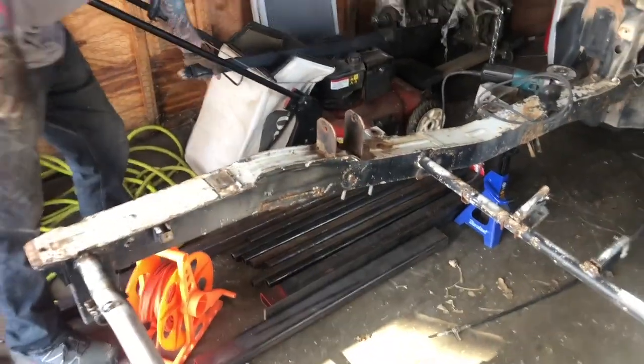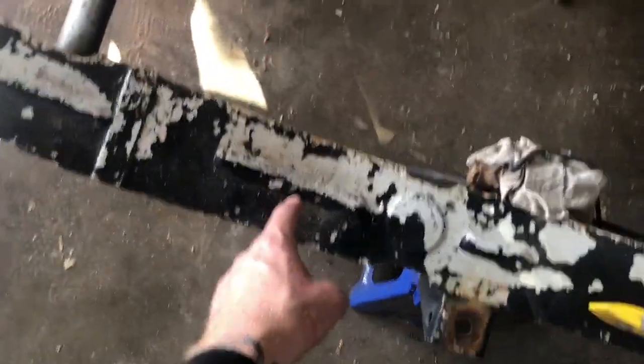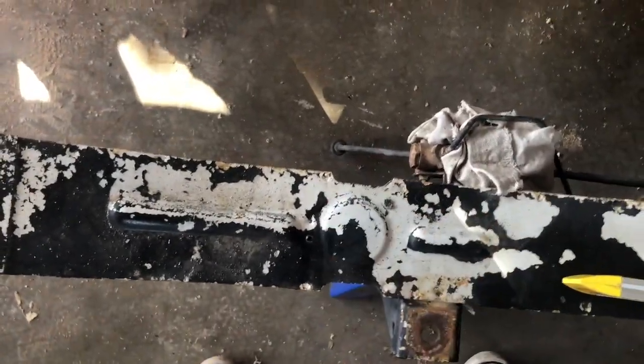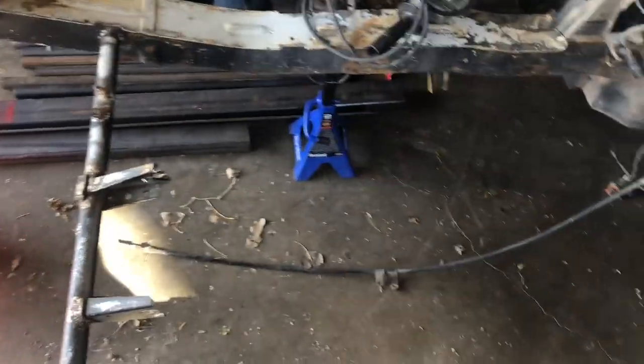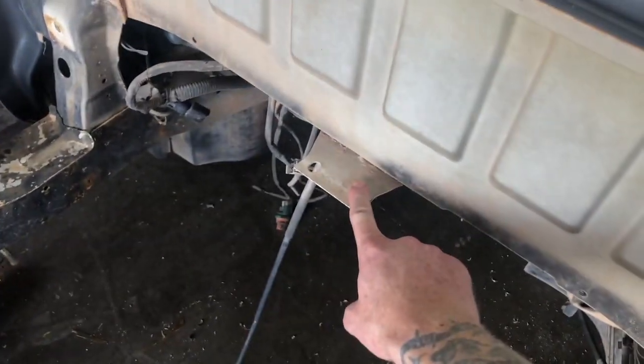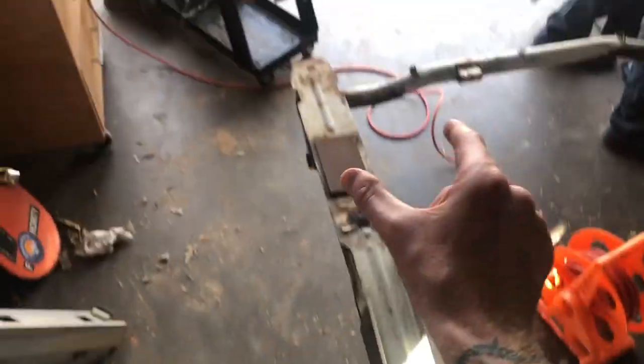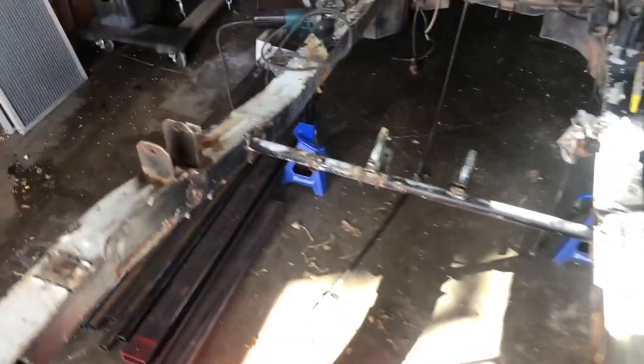We just got the new air in the wheels and the frame is pretty darn level, so we're gonna go with that. What we're gonna do is measure out even on each side right about here to cut off each frame rail, then measure how high up we want — this is where the bottom of the bed attaches — so we'll measure up from there and have two long frame rails go all the way down.